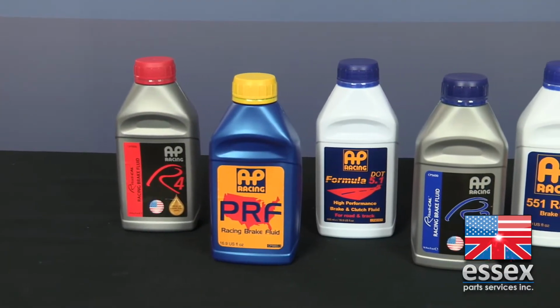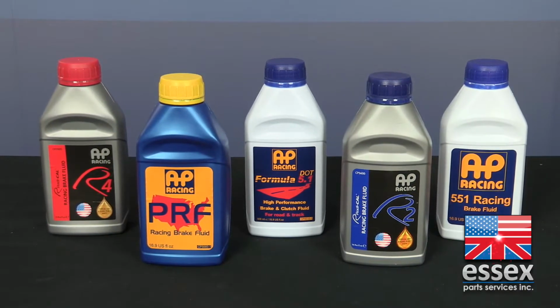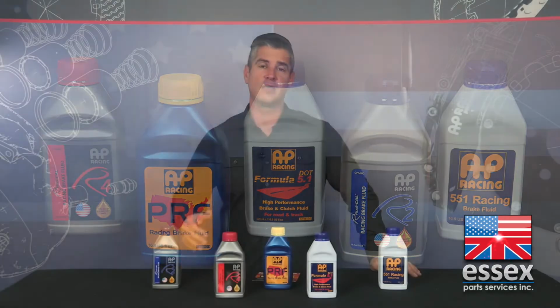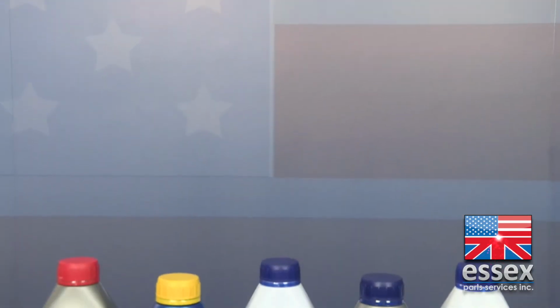If you're experiencing any issues with your brakes, then the best and least expensive place to start is with your brake fluid. If it's not your brake fluid and you end up replacing or upgrading to new calipers or rotors, then you're not going to want to use new brake parts with old brake fluid anyway, which is why testing and, if needed, replacing your brake fluid as step one makes the most sense.